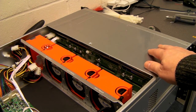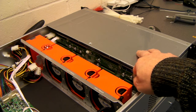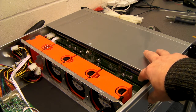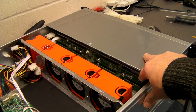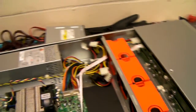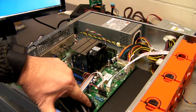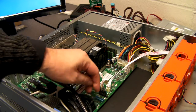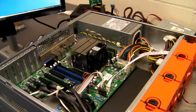The front hotswap drives are connected to this backplane — it's a mini SAS backplane with two SAS connection ports, 8087 ports. These connect directly either to a RAID or HBA card, or you can connect them to your motherboard SATAs using a reverse breakout cable. Or, as in this particular build with the Supermicro X10 SRH-CL4F, which has two mini SAS ports on the motherboard, these connect with just two cables directly to the backplane — a 12Gb connection via the LSI 3008.